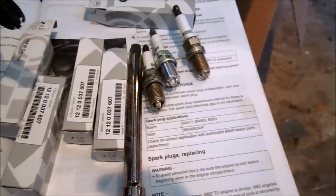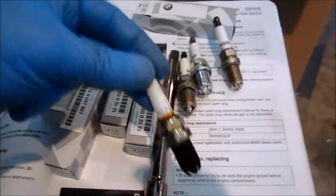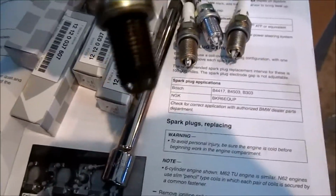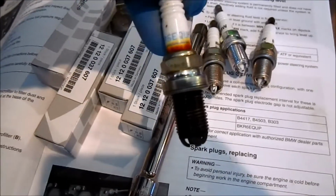So as far as the actual replacement spark plug, it's almost a religious debate whether to go OE or OEM. For certain parts of the car, I'm kind of an OE guy. I don't think there's a right or wrong way of doing it, and I'm not saying it to brag. I just chose to buy the OE ones. It looks like Bosch is the original manufacturer of these. They say Bosch BMW on there. The actual part number is, where is it listed on here? It's FGR 7DQP. The car that I'm working on here had NGK spark plugs, which are also applicable to this engine. You can see, I guess these have been here for a long time. There's some discoloration going on here on the ceramic part of the spark plug.